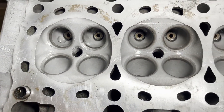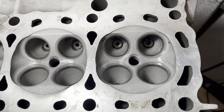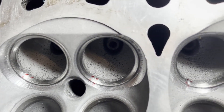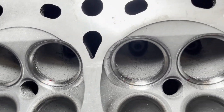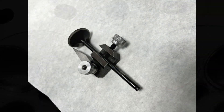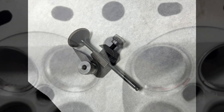After final reshaping and media blasting, this is how the head looks. The next critical step is cutting valve seats. Valve seats must be sized to match the bigger valves that you're going to use, and the only way to do that is by using a tool like you see on the screen, which will accurately match the seat cutter angle with the size of the valve that you plan to use.